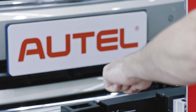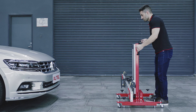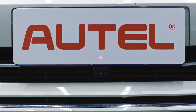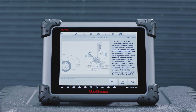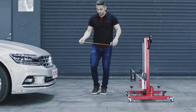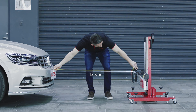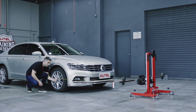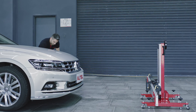Turn on the laser and aim the beam at the front center of the vehicle. Adjust the height of the crossbar so that it is level with the center of the front wheel. Move the frame slowly to reach the specific distance between the vehicle emblem and the crossbar sliding plate. Ensure the beam of the laser is pointed at the front center of the vehicle and that both sides of the crossbar are at the same distance from the center of the front wheels.